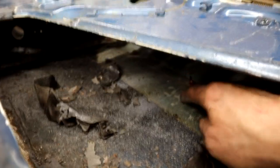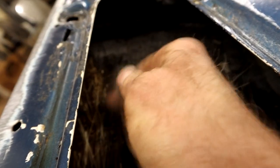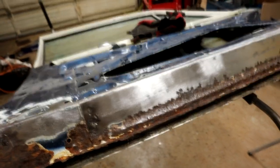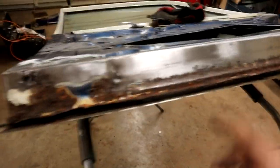Because if you see there, there's none of that stuff up there. That looks more, well, it's got some overspray from the respray of the blue, but that looks more factory. This is the sound deadening panel here. But yeah, I reckon someone sprayed in some stuff and blocked the drainage holes. And just like the underseal stuff on the underside of cars, it makes everything worse. Instead of just maybe using some of that wax oil or CRC stuff, you know, that wax oily stuff, and then clearing your holes, making sure they're clear, then you're better off. Not this tarry junk. Yeah, that's no good, is it? I'll scrape all that off. I was getting a lot of smelly burning stuff when I ground this edge off.